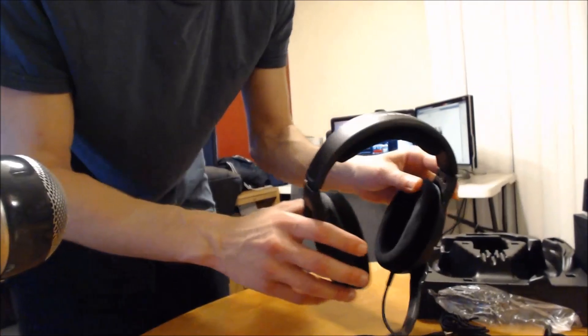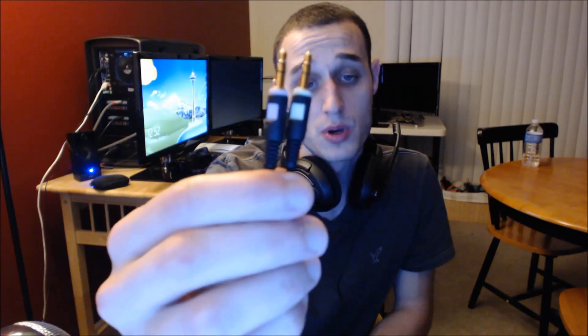Back in front of the computer - I wanted to show you how to set this up on your PC. You have two separate options. You have your normal mic and audio jack - you just plug that into your computer and you're good to go. Now if you want to take advantage of the Dolby surround sound, you use this little adapter. It has a USB on the other end which you plug into your computer, and you install their software - it's on the website and it even comes with a CD. You plug the two audio cables into the corresponding jacks on the adapter, and there's a little switch: flip it over and you get Dolby, switch it back and you're off Dolby. That easy.